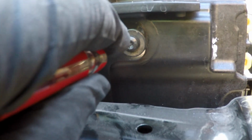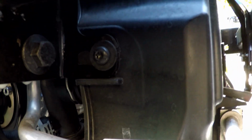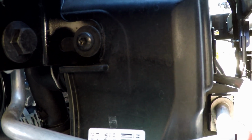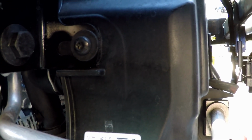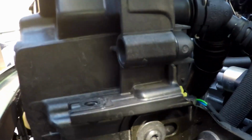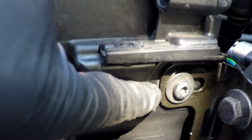And let me show you something. You see where the screw's at here, and you can see the washer here, and it's almost near the end here. Actually, it is about touching, but check this out. On this lower one right here, see, this washer is actually sticking past here. So this is why this is so critical, because if you were to just put this back together and set the screws to the same depth on all these brackets, you'd end up with this probably crooked. So you can see this washer sticking past the edge. And then if we go look over here on this side, it's totally the opposite, right? Look at this. The washer's way far back in here, and the bracket's sticking out past it. So again, I've marked these, I've scribed these. So I'm going to go ahead and take these out.